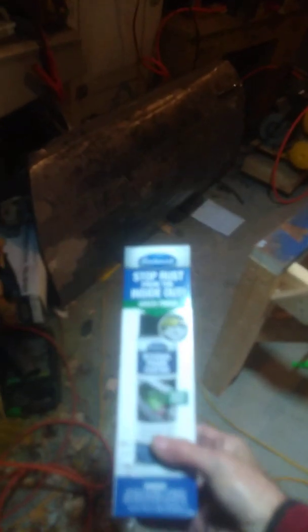But one thing they don't talk about much is undercoating, or sealing the car. This stuff here works great. Let me get some light here. Maybe this will help, and maybe it'll come through. My phone camera sucks. No, that's not really helping, is it? It's Eastwood's internal frame coating. This is like $30 a can, so it's not cheap. And one can did both my rockers.